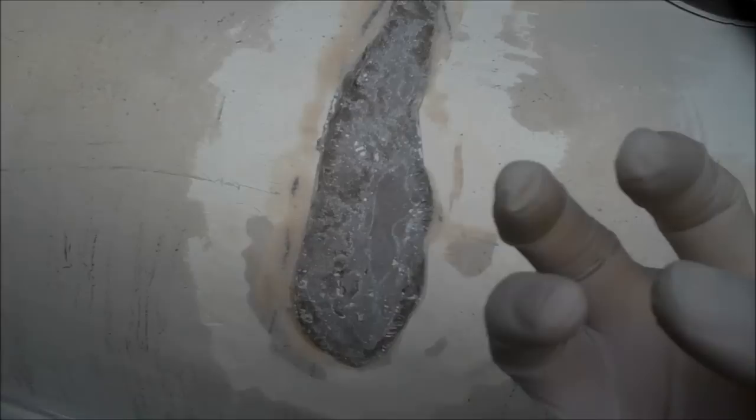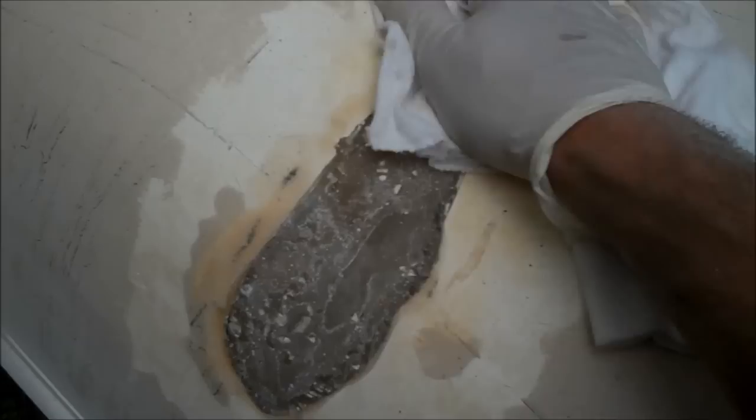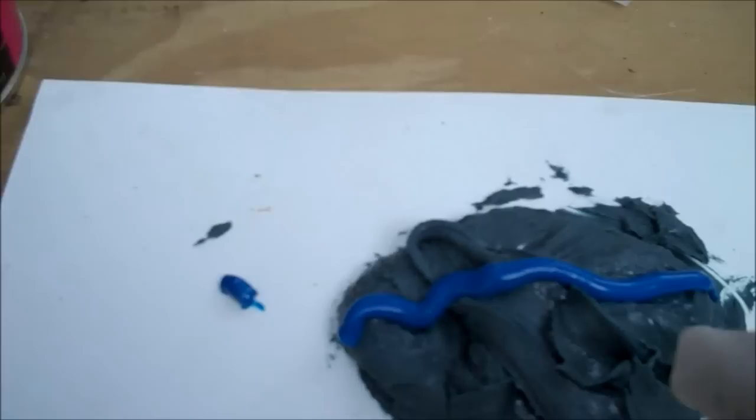I'm working with two types of bonding — a chemical bonding and a mechanical bonding — and by roughing it up before I put on any filler, it helps with the mechanical bonding process. It'll create little lines and cracks and gouges in there, and that'll help the filler dig in. Clean the area with acetone as well.